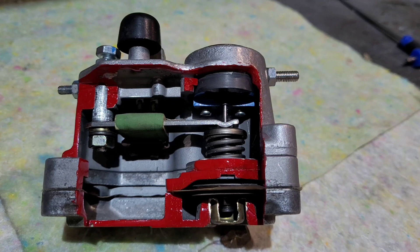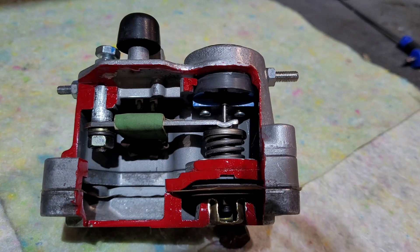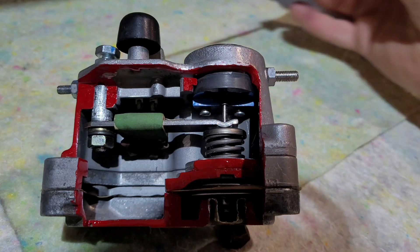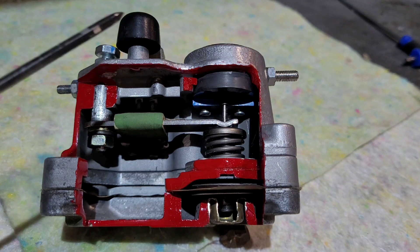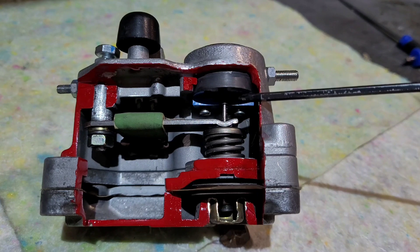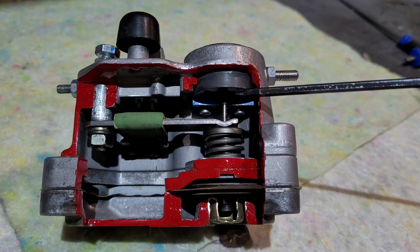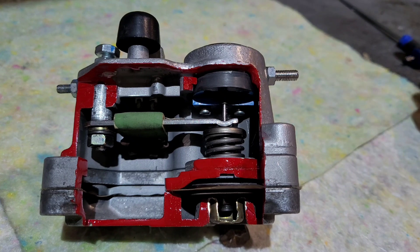Welcome back to the next installment of Inside Truth. We have a warm-up regulator — the inside of it — because I like cutting things apart and showing you how things work inside. This is the warm-up regulator 16-valve version with a vacuum device. Ignore that for now; we'll come back to it shortly. Inside here we have our bimetallic strip, which is your warm-up element, with a little pin that sits on the disc — you'll see it in better detail shortly. It sits on a little top-hat with a fuel inlet port and a fuel outlet port covering two holes.